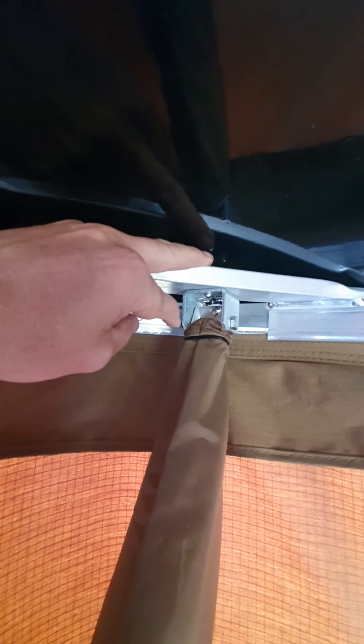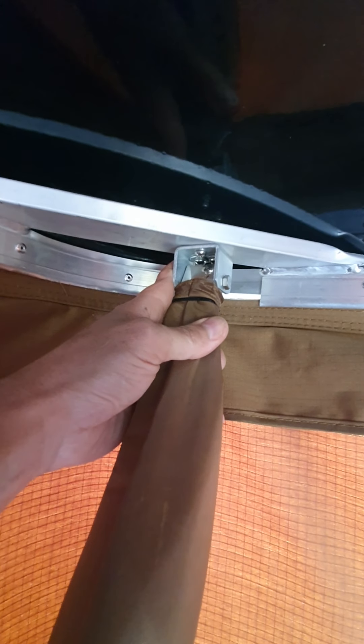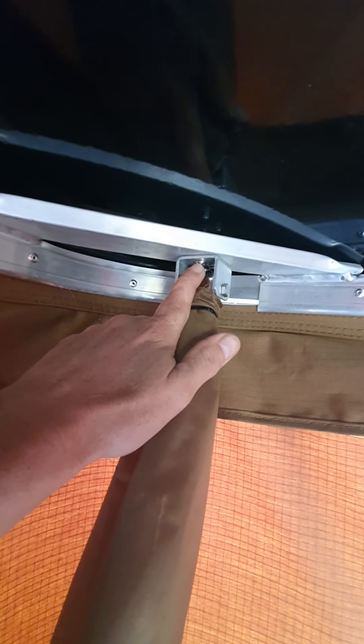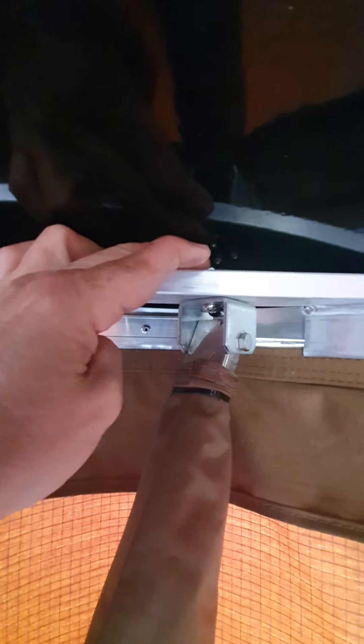The issues that I have had — I'll just flick the camera around. Up in here you've got these struts, these strut mounts, one in each corner. The issue that I found was there's a screw with a locknut at the front of this bracket, and at the back of the bracket there are two rivets. What I found after 1500 to 2000 k's on the dirt, these locknuts on all four of them actually work themselves loose.